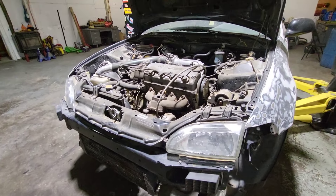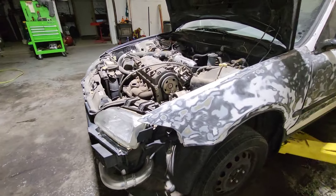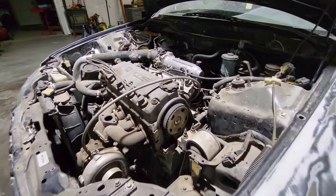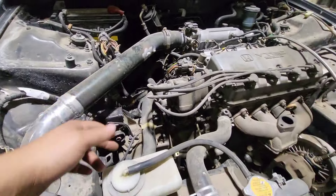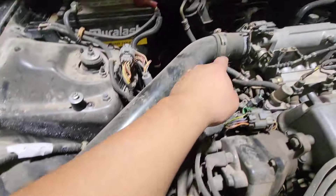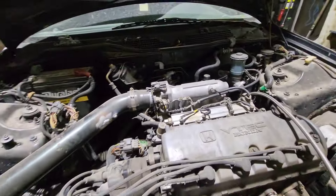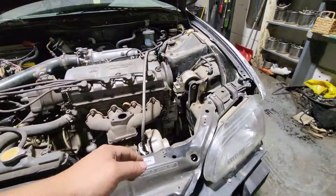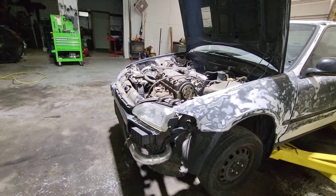Regardless, I gotta pull this whole engine out — this whole swap is coming out. I'm gonna put it on timelapse so you guys can see it. One thing I have to change is this post mount, which I grabbed from that other car. When I pull the engine I really gotta remember to replace that. He gave me most of the mounts — the bracket for an EK — but the baby mount, the rear T-bracket, and the post mount all need replacing. I'll unplug from here, remove the axles, remove the shift linkage, and the whole thing goes down. After that I'll bring that red coupe in and put this in there.